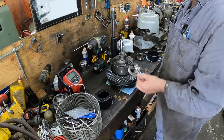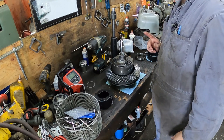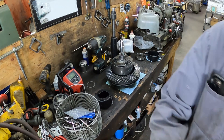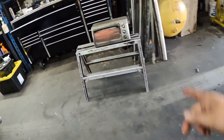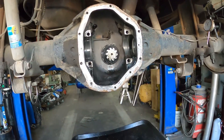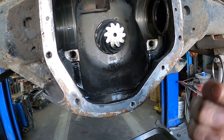I'll have to pull the bearing off the other side and put this shim in there so that I keep the preload — the preload was pretty good. What I am waiting for right now is the bearing in my toaster oven. That's what I use for heating bearings — just a cheap toaster oven. I put it on bagel and cook the bearing. You're trying to get the bearing basically straw hot — I want to say it's around 375 degrees. I pulled the carrier all out and I got a little bit of debris in there that I need to scrape out.